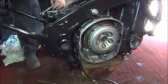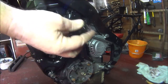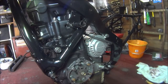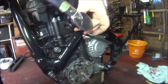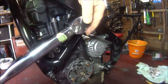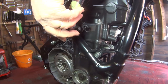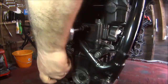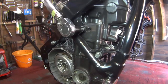Now we can go to the front for the 10mm bolts. So this is one of the 10mm bolts — a 14mm spanner head. And like I say, these are 33 foot-pounds. It doesn't seem a lot. Same on the other side. There we go. 33 foot-pounds.